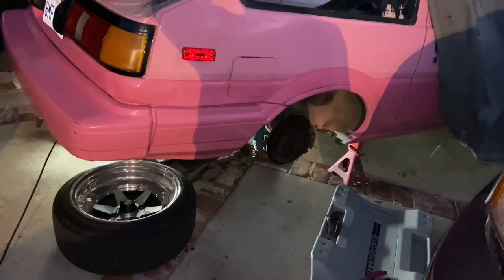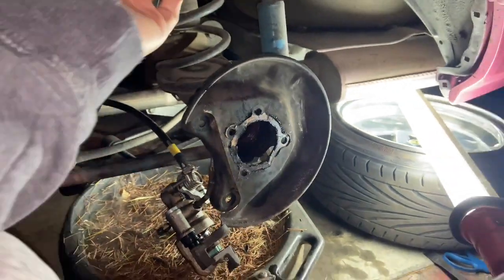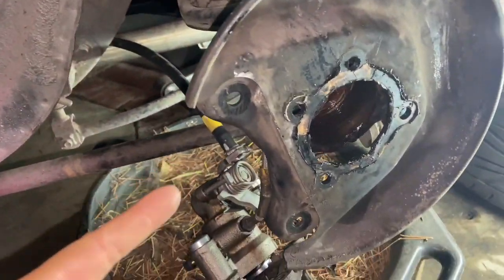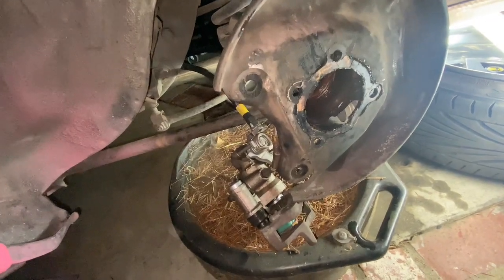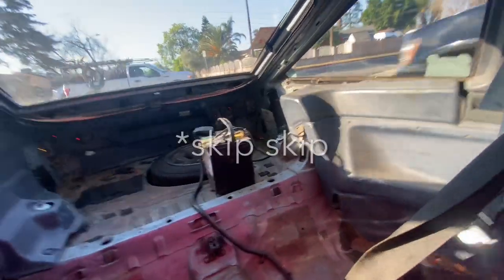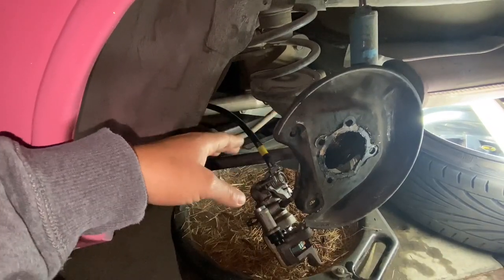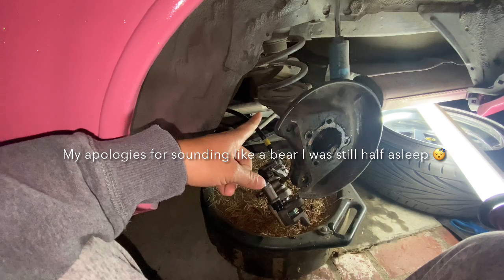And we're currently removing the axles. As you saw, I installed a new diff, and this side had a ton of play that I hadn't noticed until I started driving it yesterday and I heard some noises. I think that one of my axles was Zenki and I ordered a Koki diff, or both of my axles, not sure. We're testing it out now.